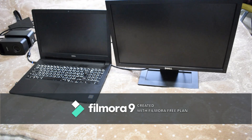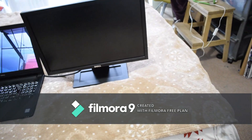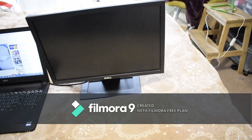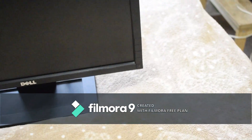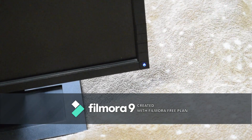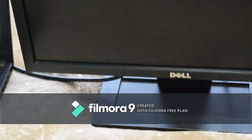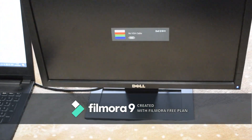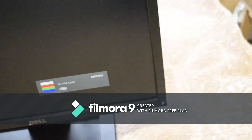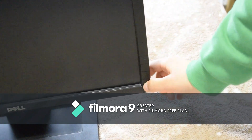I'll be back when it signs in. Now we'll turn on the monitor — press that button. You can see the blue light. It's saying there's no signal, but we need to set it to DVI. Even though we're connecting through HDMI from the laptop side, the actual port on the monitor is DVI, so you need to set the monitor input to DVI.